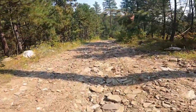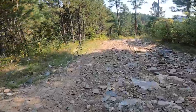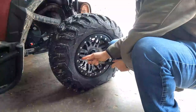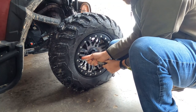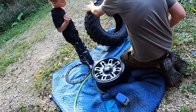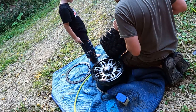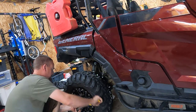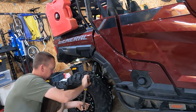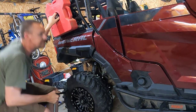As mentioned, we've put over 2,000 miles on these tires. We've hit some bumps and terrain really hard, smashed the sidewalls — you name it. We've had zero punctures, haven't thrown any beads, and they've held up really well so far. I do currently have one tire that's leaking a little bit from the inside bead on one of the rear rims. I pulled it off the rim, cleaned the rim, cleaned the tire, reinstalled it, and I still have a small leak. I need to pull it off and look again. It started after our 650-mile Black Hills overlanding trip, so I don't think I can blame the tire. It could be a piece of gravel in the bead that I missed, or I may just need to remount it and use some bead sealer to patch that leak.